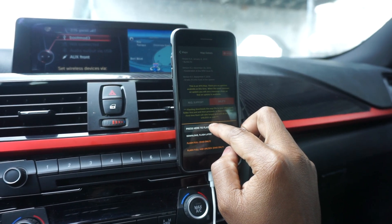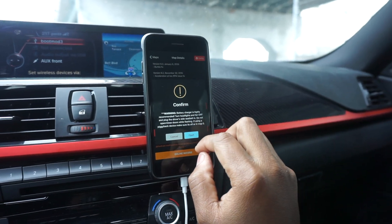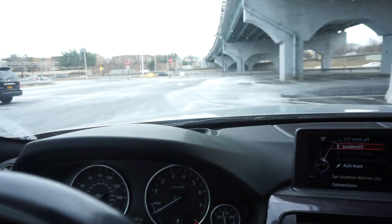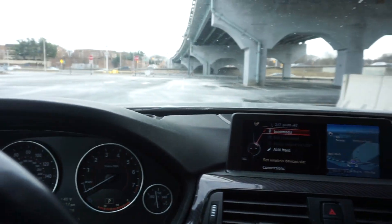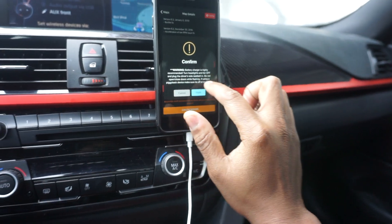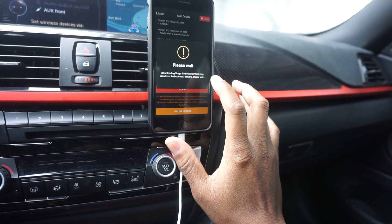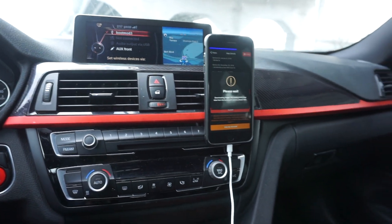I'm not gonna speed up the flash for you guys so you can see exactly how long it's going to take. Press here to flash now. Battery charge is highly recommended — headlights off, fan off, and plug in the driver's seat belt — all of which I've done, except for plugging in a battery charger. I do not need one, but I do recommend you guys use one if you're not familiar with it. Do not open and close doors while flashing — I've learned that. Now hit flash.